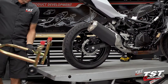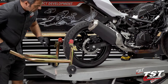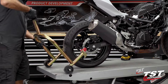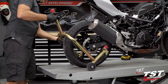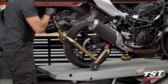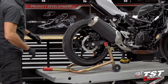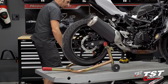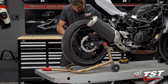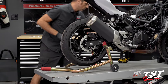As mentioned, we will need a padded stand so that we don't take up any of the lifting geometry on the swing arm and can still manage to get the wheel up. Now I'll drop the cotter pin out of the nut that fastens the axle on. Once that is off, we'll be able to take the axle off and the wheel will come out.